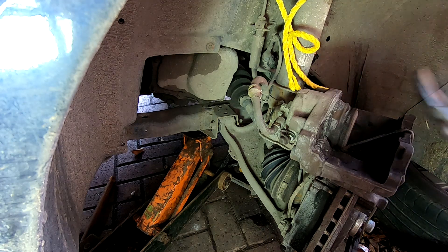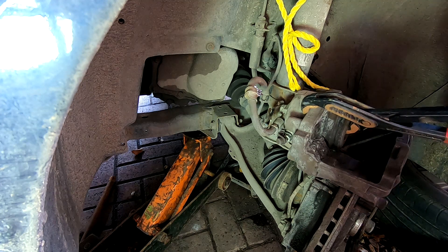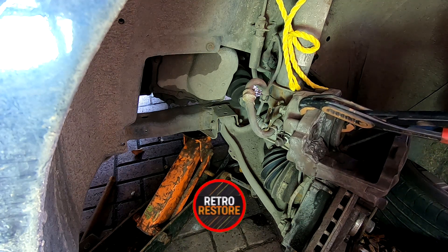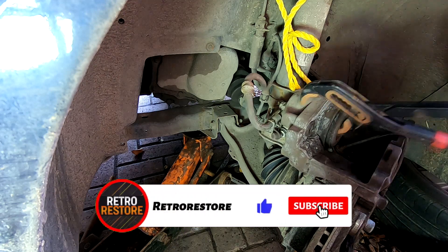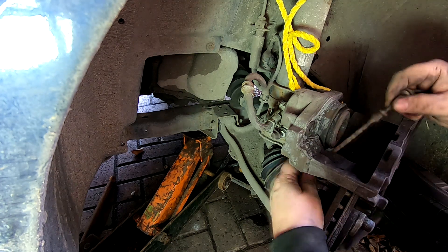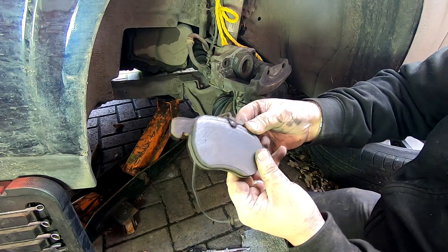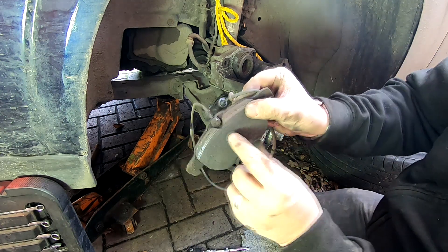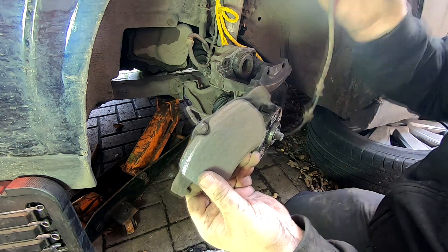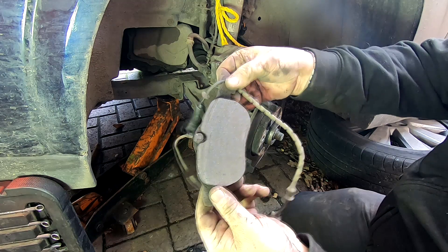You might find it handy if you've got a large pair of grips here just to ease that piston a bit easier. And what you'll probably see is that our sensor there on the edge has been rubbing on the lip of the disc - so that's what's caused our indicator light to come on. Done it at the right time.